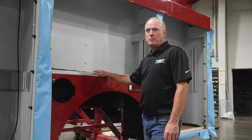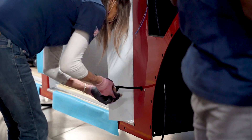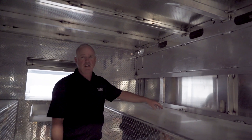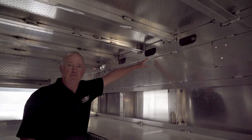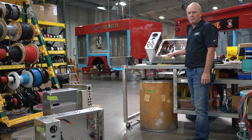Once your body comes out of paint, the first process is wiring. Here we pull in all of your electrical looms and start putting on lights on the interior and exterior. Inside this body, you'll see the protected wire raceway that all of our wiring runs into, with access holes so you can access it at a later time if you need to. We also build up our 12-volt panels, whether they're relay controlled or V-Mux.